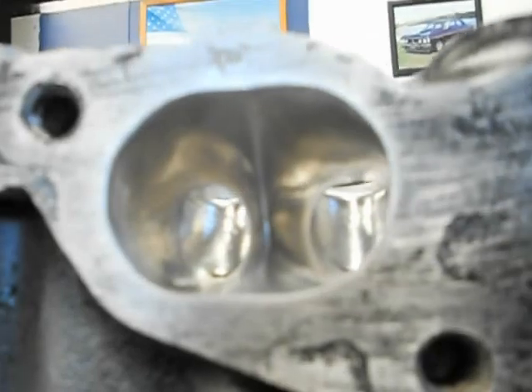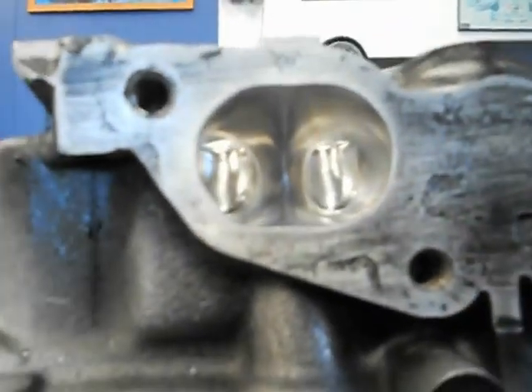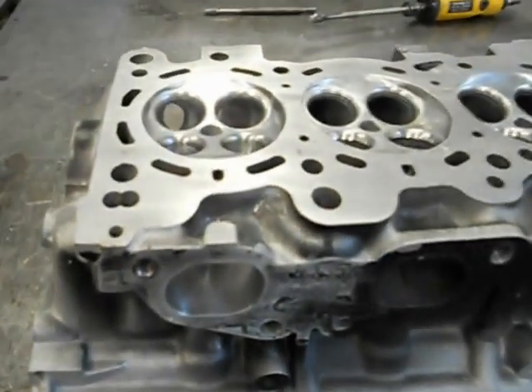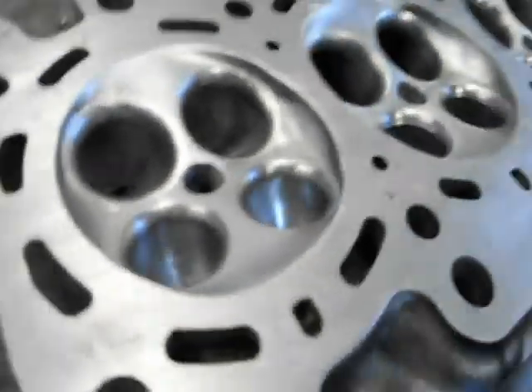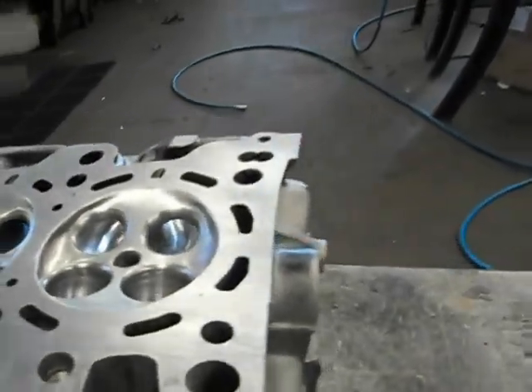Now this is not fully finished — I've just got to highly polish the exhaust. But what I do after I've ported them is shove them back in the sandblaster and blast them all just to blend everything in, then give the exhaust and the chambers the final polish, and just leave the inlets as is.